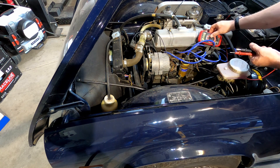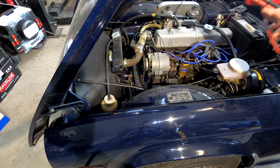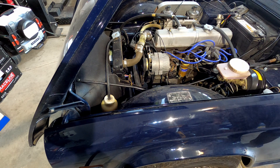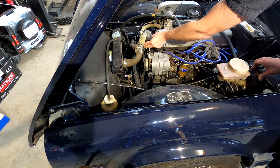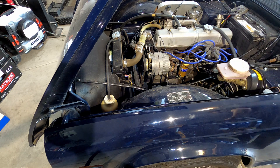That tells me both the fuel and the temperature gauges are getting erratic readings — they're both affected by the same problem. So it's pretty clear what we should try next. I think we need to switch the voltage stabilizer out on the back of the speedometer and see if that helps. Don't forget to plug the coil wire back in.